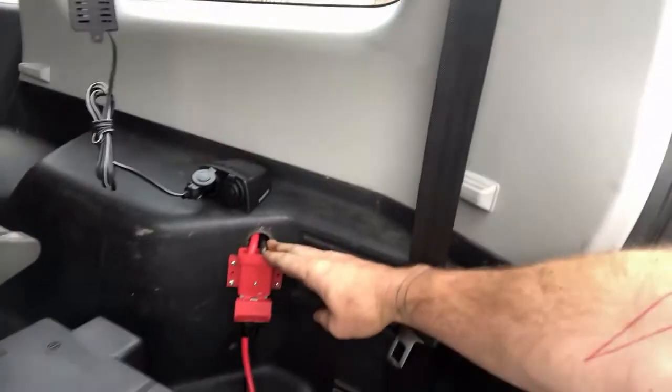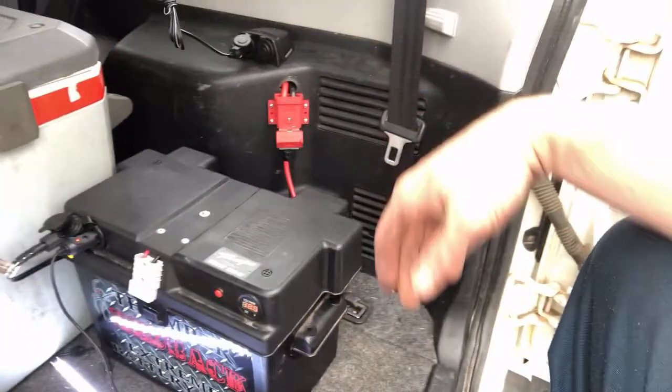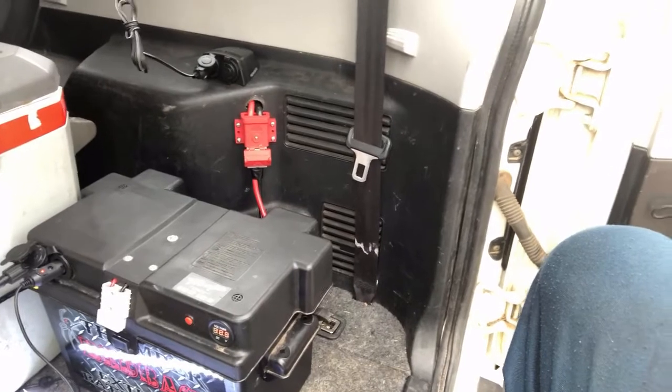That's why this dual battery kit comes with 50-amp cabling, which can handle charging the dual battery as well as the current draw from your appliances. So that's one other thing you might want to do when you install your dual battery kit. That's the Enerdrive dual battery system from mygenerator.com.au — it's just an entry model unit, cost me about $140, and it's perfect for what I need.